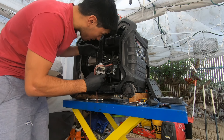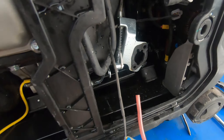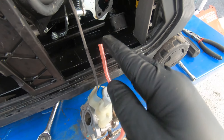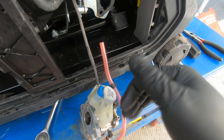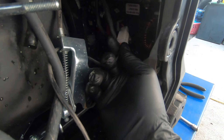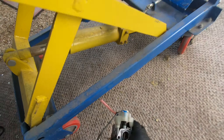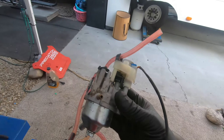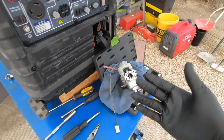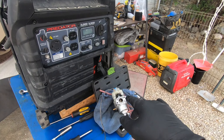I wanted to show you guys something: this stepping motor controls the throttle so you can adjust the speed electronically instead of mechanically. There's a wire running here, and it's very nice that the designers actually left us a plug right here so we can easily disconnect the carburetor. Anyway, she's out. Next I'm going to put the camera up there pointing down and show you guys how to clean the carburetor.